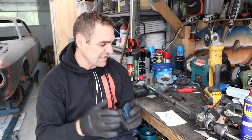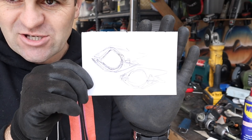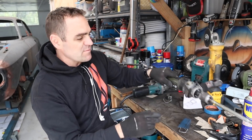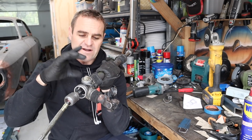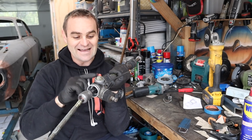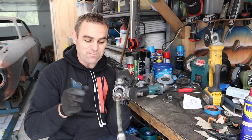I did do a bit of a sketch — a scribble really — but that's what I'm going to try to build. I'm going to use the original mounting points for the steering rack, using the original rubber and this squared-off boss. I need to keep that so the steering rack doesn't twist in the car. That will hold it nice and solid in the perfect spot. Let's continue to cut up a few bits and pieces and I'll explain along the way.